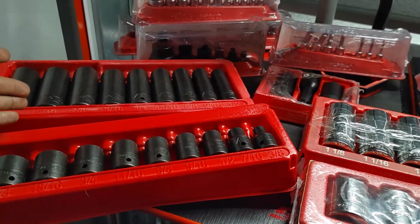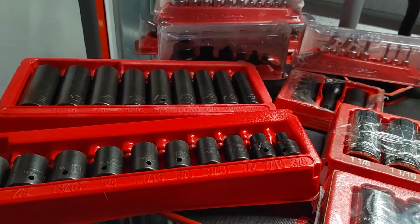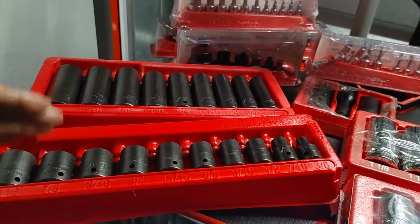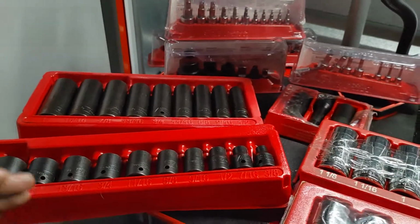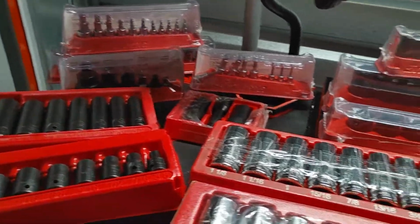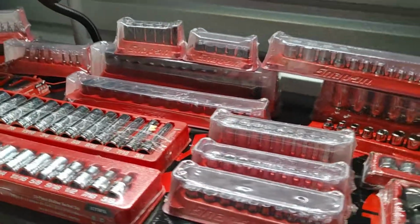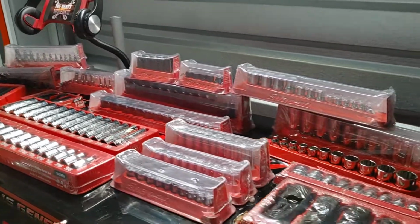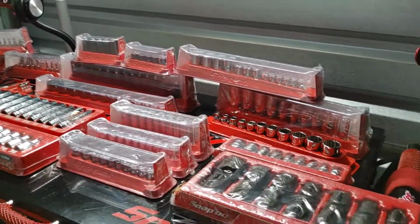There's like five to six other sockets that actually belong with this particular set, and then there's even more higher sizes when you're moving into the axle nut sockets in SAE standard. I showed the axle nut sockets in the metric, but you do have those larger measurements in SAE standard just as well. A lot of this equipment, like I was stating, nowadays we don't use much SAE standard in the automotive service field. Everything is a lot of 6-point metric and 12-point metric nowadays.